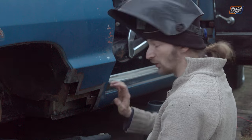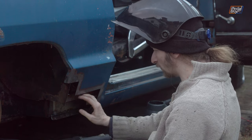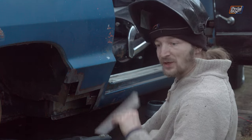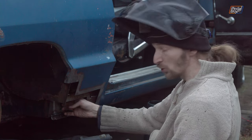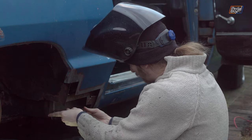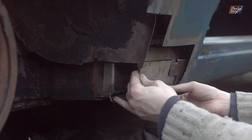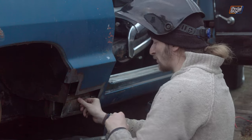The situation's a little bit worse than we hoped but not as bad as we feared. We had rust on the outer panels and cut through to get at what's underneath. Inside there's what looks like a frame rail or inner sill — pretty beefy — and we've had to cut quite a lot out, which means we're making four new pieces of metal. We could potentially get these off the shelf but they're thousands of miles away in America, so we're making our own from sheet metal offcuts. One piece is already in on the inboard side — the inside of the inner sill — and I've got a few more pieces including one for the outside of the inner sill, and then we'll box in the back with a shaped piece.